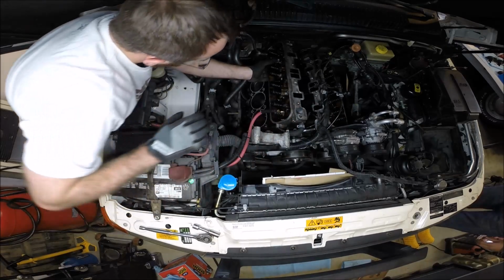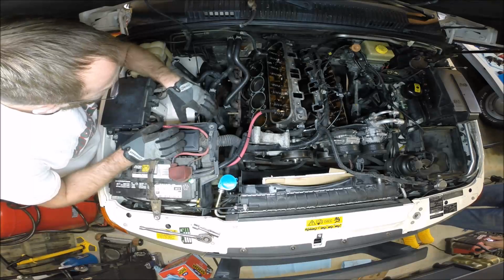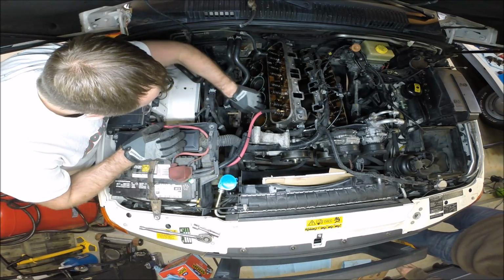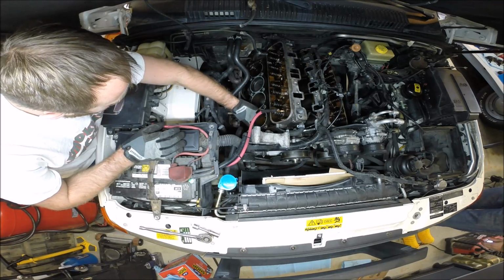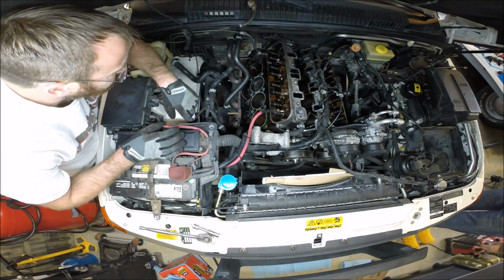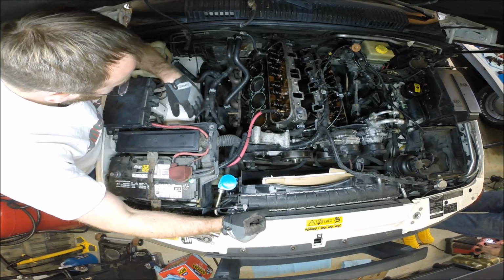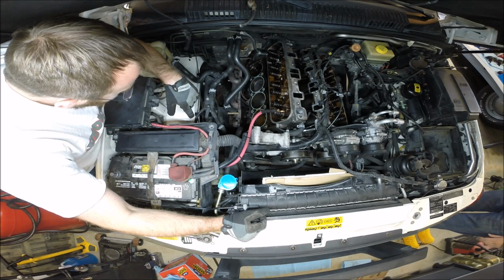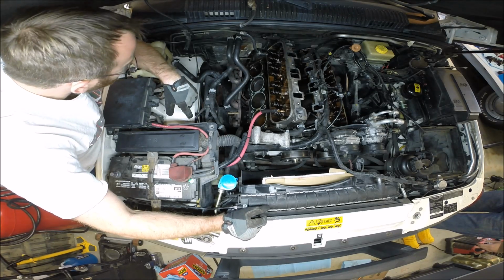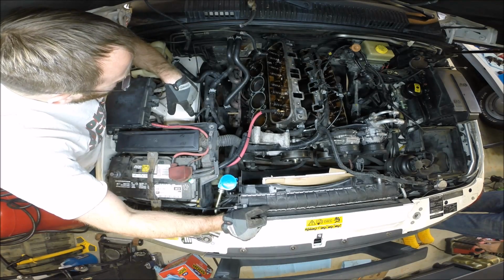And clean all that off when we do our oil change. The block looks okay, the gasket looks okay. I had a failure in the front cooling jacket that carries coolant up into the head, and I was seeping oil and coolant down the face of the block. Everything looks okay. I don't have any steam clean cylinders, that's good. And we'll go ahead and tidy this up and take a closer look.